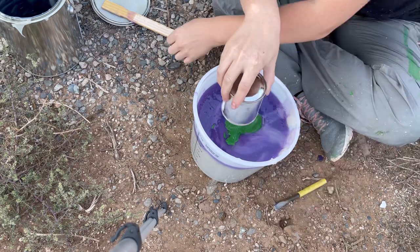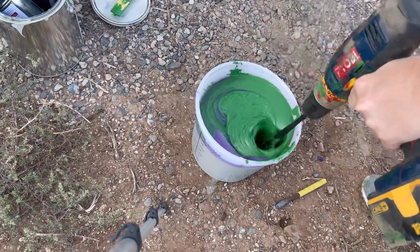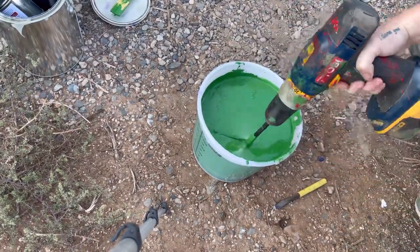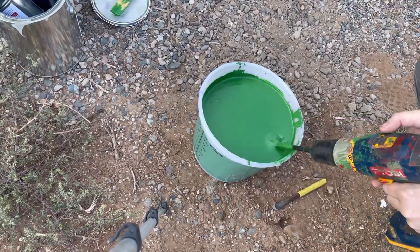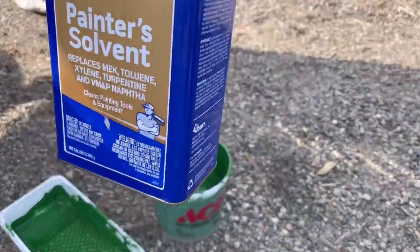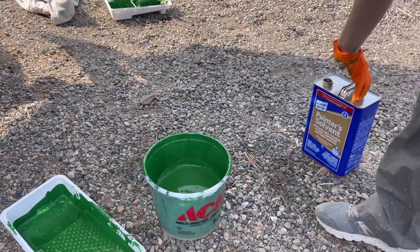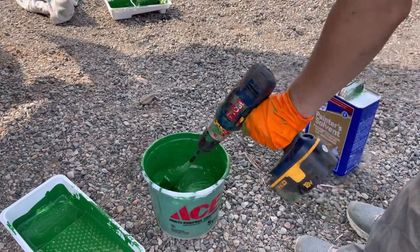The best thing about these Monster Liner colors is that they are UV permanent. Years from now, this color is going to look just as good as the day we're putting it on the bus. When you mix, you want to mix for a good three to five minutes. I like mixing in these clear buckets so I can see that it's clearly mixed together. You can also pour MEK on top every time you need to step away, then mix it back in — this helps extend the working time, as they only have three to five hours of pot life once mixed.